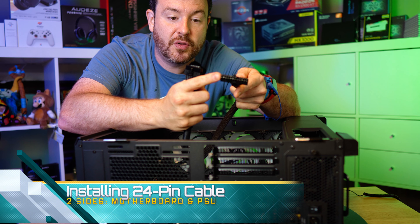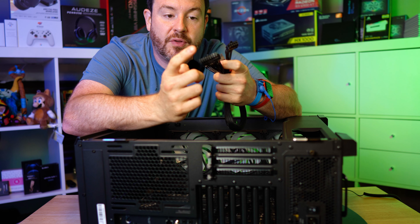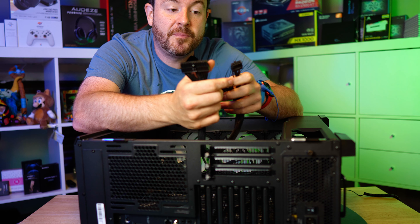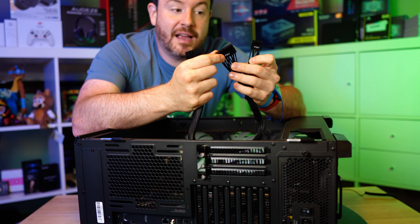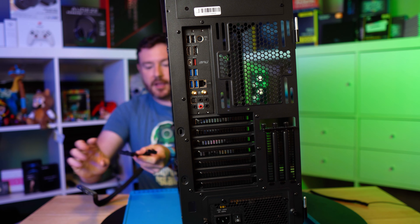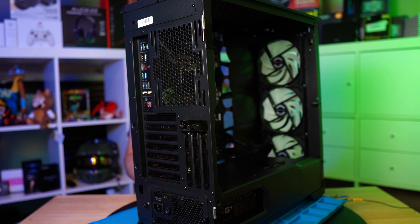Screwing this down is simply a matter of putting the screws in — not a complicated thing. Once it is mounted, nine screws are down: three at the top, three through the middle, three on the bottom. The next thing I'm going to do is attach the 24-pin connector. This will help you test and make sure the motherboard is in working condition — it's not going to be a full test since we're not adding components, but we want to make sure the motherboard can at least power on and show error codes.